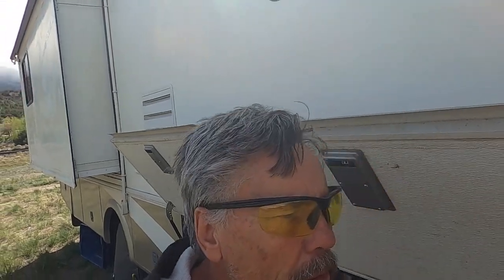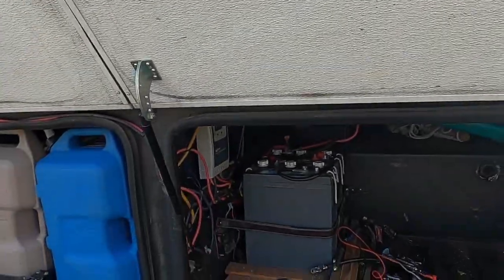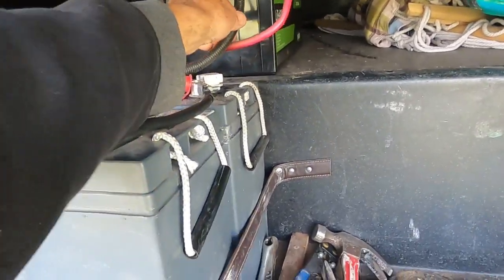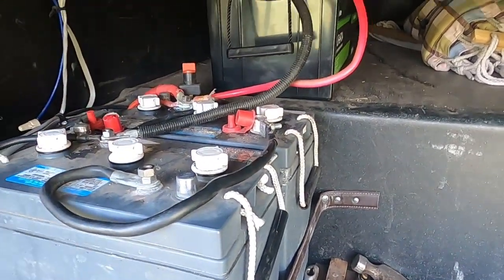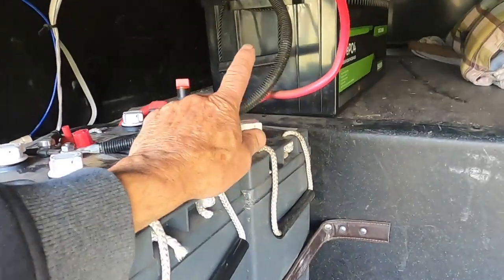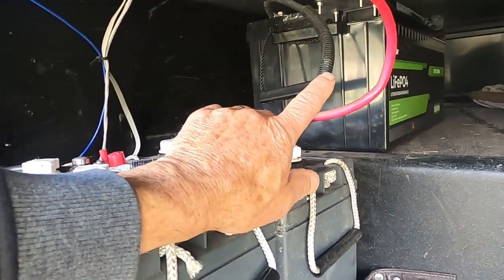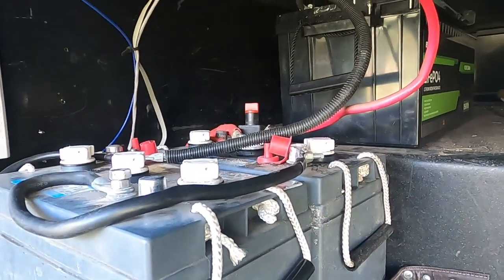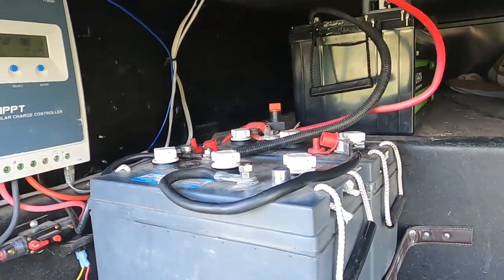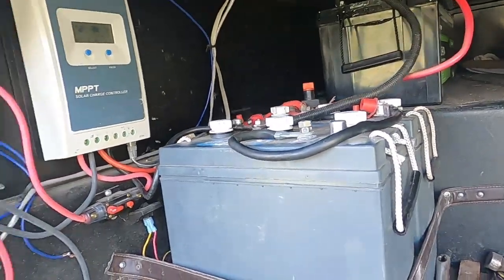Hello again brothers and sisters. I've been hooked up for about an hour now and so far there's no indication of any problem whatsoever. The wires are nice and cool. The lead-acid bank is up to 13.6 volts and the lithium battery has equalized out to 13.6 as well — it's getting a charge. The one thing I'm not going to do is try to charge these batteries off my alternator, because I know that's a problem — though some people seem to think it's not.